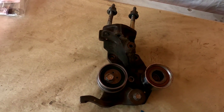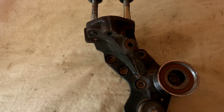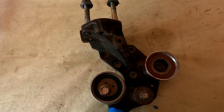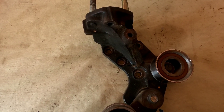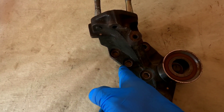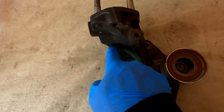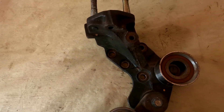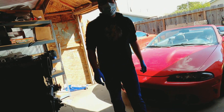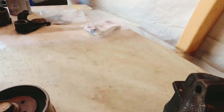We're looking at a 2G motor mount bracket, and as I was explaining earlier, there's actually one bolt hole that we need to get rid of because it's in the way of the water pump — it will not clear the water pump if you try to install it as-is. The bolt hole we're trying to get rid of is this guy right here. The way we're going to do it is we're going to slice this motor mount in this direction and cut as much as we can closest to this curve here, and that should give us enough clearance. George is going to do us the favor of chopping down this bolt hole with the grinder.